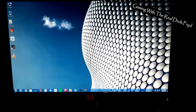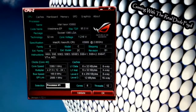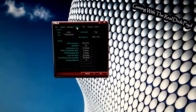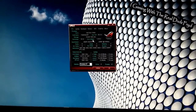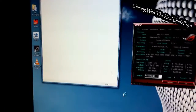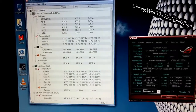This is coming up on a hard drive, not an SSD — I still have hard drives in here. Opening up CPU-Z, you can see we've got the specs here — very conservative specs. Basically we're running 1333 memory, which is just fine. That's all it needs, because remember we've got triple channel memory here, and we've expanded the bandwidth of the memory, which means what we used to do with speed we can now do with bandwidth — it's a ratio. Opening the hardware monitor, you can take a look at what it's doing at idle. This thing's been running for a while, and you can see the idle temps are pretty good for a 91-degree Fahrenheit room.